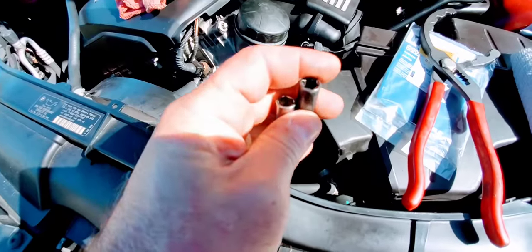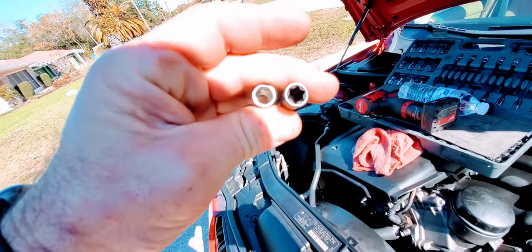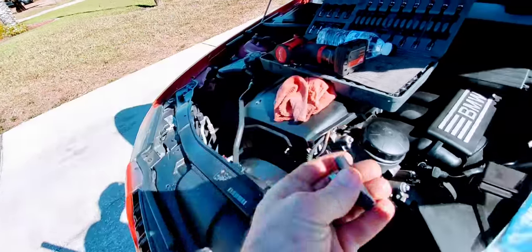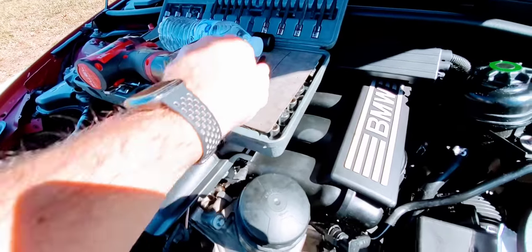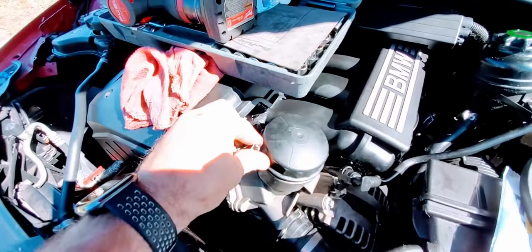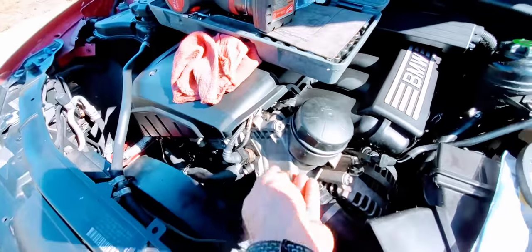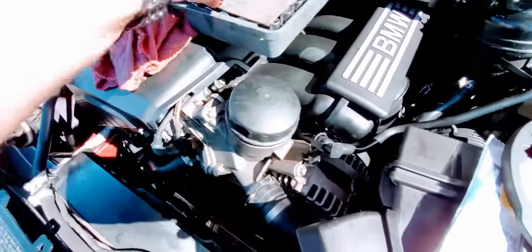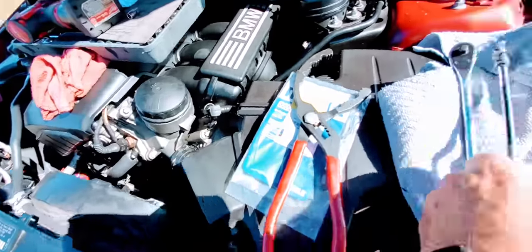Before I go ahead and take that off, you can take a look at the two differences: on the left is an 8mm quarter-inch drive socket, on the right is an E10 — you see the star pattern. Obviously that's designed specifically for that, but I don't have a short one. The 8mm is very tight, so it's kind of a backup last resort. If you're not going to take off this hose, you'll want to use the shorty with either a wobble or swivel.